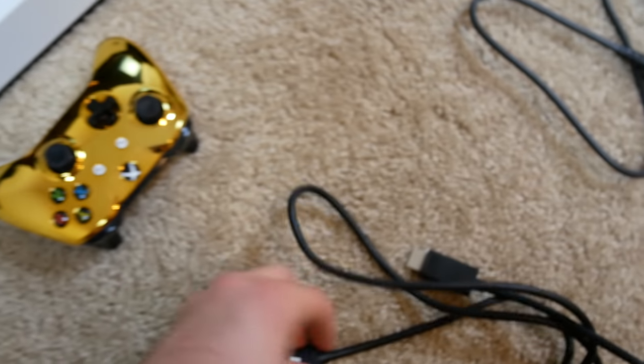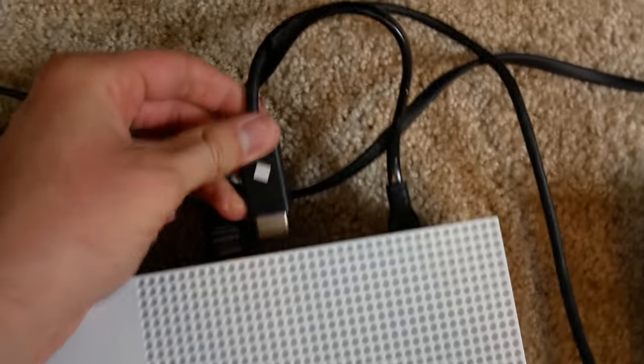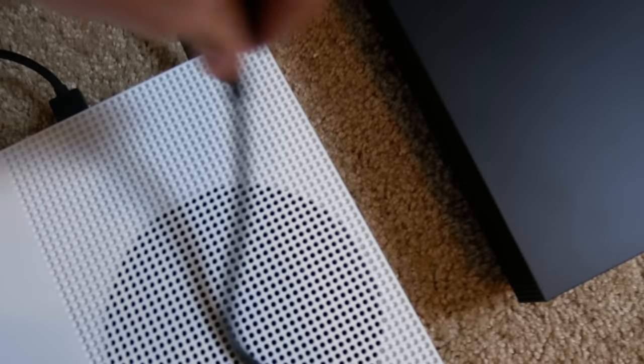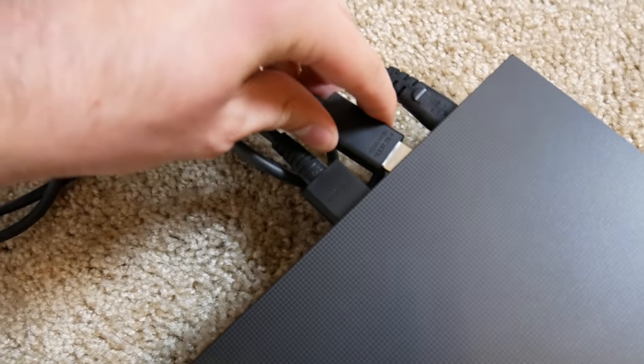So that's the second port. Then I grab another HDMI cable and plug one end to the output HDMI of this console. Now I've got that end plugged in, so I'll plug the other end into the pass-through port on the next Xbox One. And last but not least I've got to connect the Xbox One S to the Xbox One X, and then the final thing is to plug in the HDMI that actually goes to the TV.